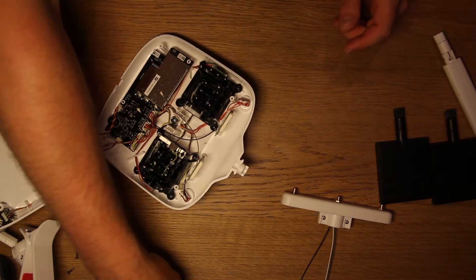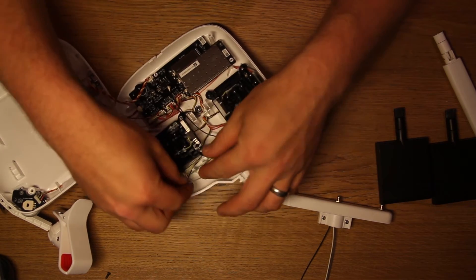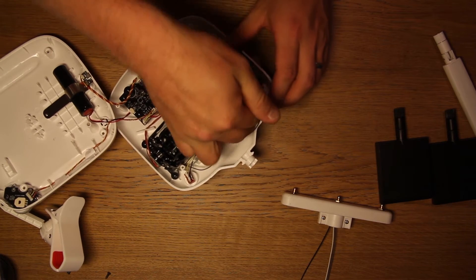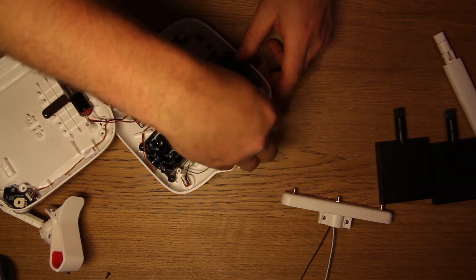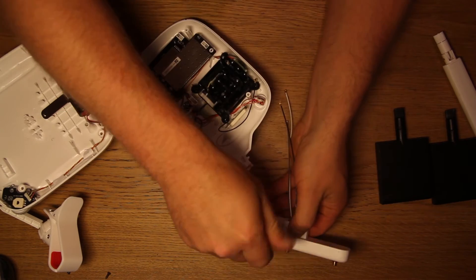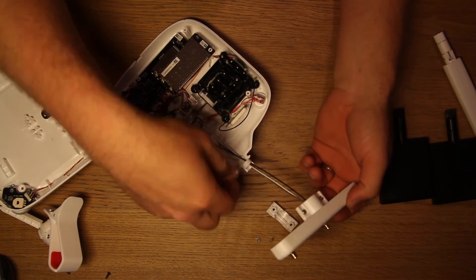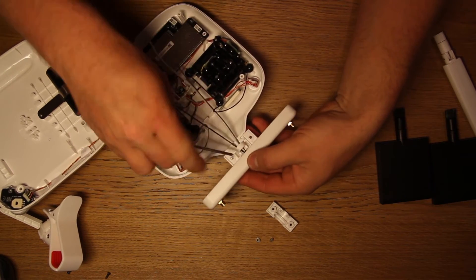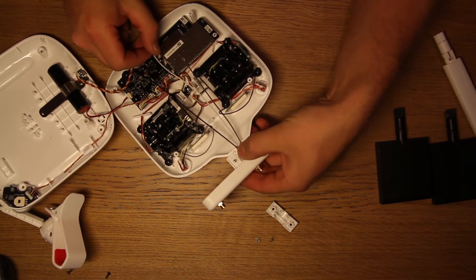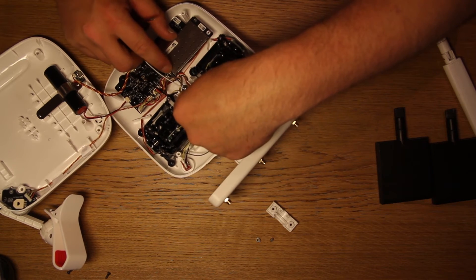So that's the original antenna out. You don't need those ones anymore. I've seen some people removing those antennas but I haven't bothered. Just get those cables off to the side so they're out of the way. Then what you do is feed the new cables through — we'll take the bracket off first and then feed the three cables through the hole. It's got grooves in here so they clip in, but it'll be loose because I'm not putting the top bracket on until everything's back together. As you can see, the cables have different lengths, so the gray one goes first to the top.